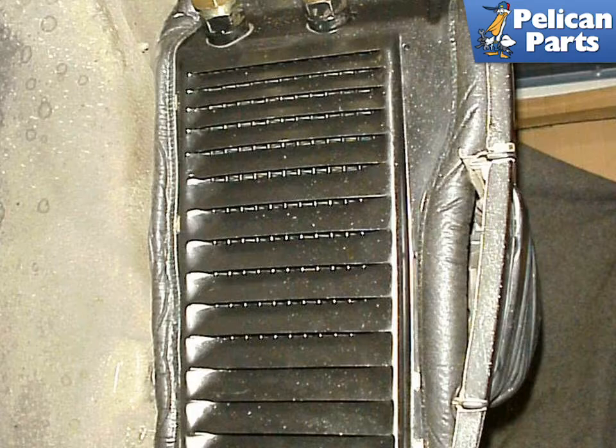The Carrera oil cooler is shown installed here in the front fender well. The lower bracket must be welded to the inner fender well in order to firmly mount the cooler. Note how the large seal that surrounds the cooler mates with the inside walls of the fender. The rock guard for the cooler is clipped onto the side of the cooler and prevents rocks and debris from hitting the fin portion of the cooler.